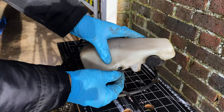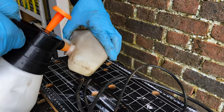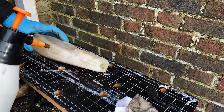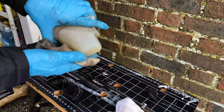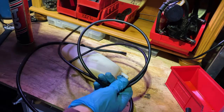I wasn't going to touch the coolant reservoir, but when inspecting the overflow hose, I saw it had pretty much deteriorated. So I ordered a new hose and gave the whole tank a good clean inside and out. And thanks to the magic of editing, the new hose had already arrived, so I stuck that on.